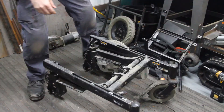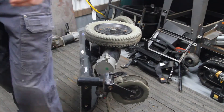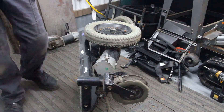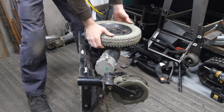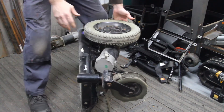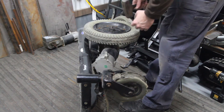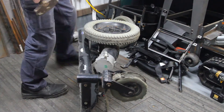There it is. Same process on this side — let's take the hub off. Let's hope that this one comes off as easily as the other one did. Three-quarter socket. The good thing is, because of the way this is machined, by hammering on it it's not going to mushroom it out and rivet it on there.